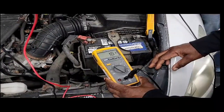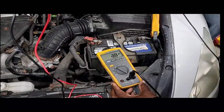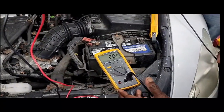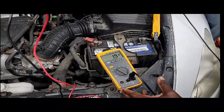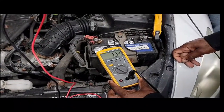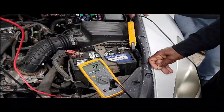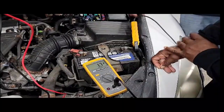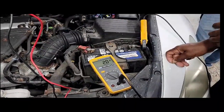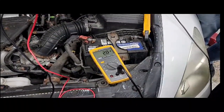It's a really small amount, and that's an important part. This is what screws people up on this — remember, because it's every hundred, you've got to move the decimal over. You're pulling 20, or 19, or 18 milliamps, whatever it's bouncing around to. And you're not banging out any relays or taking anything out of the circuit. This makes life a lot easier. Use the right stuff — the Fluke I-30S amp clamp is the way to go.